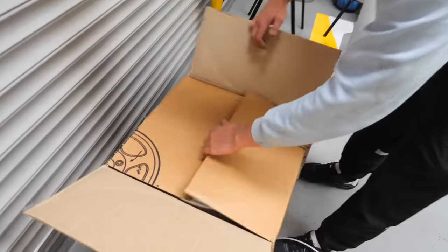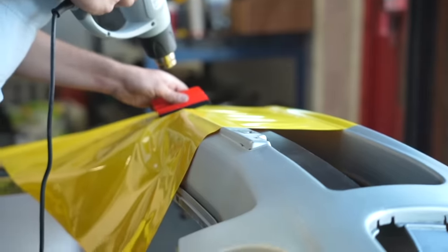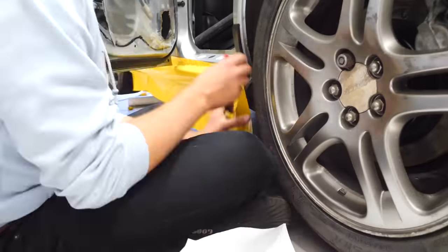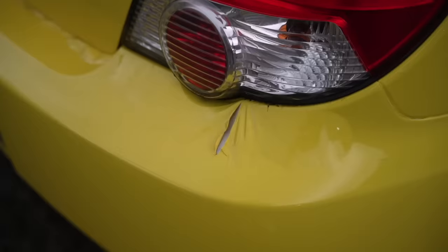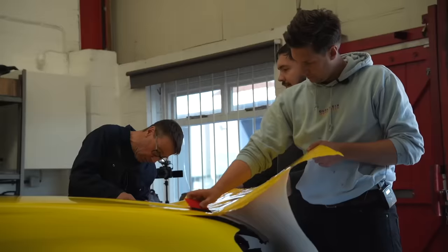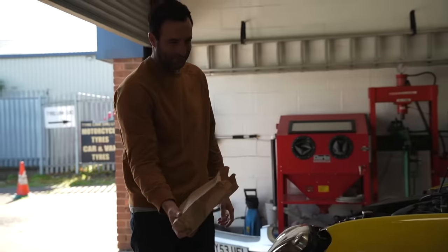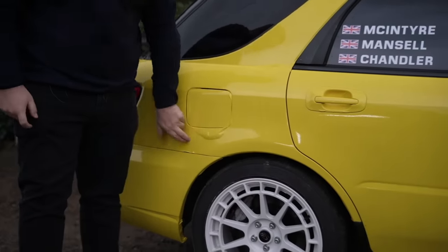Scott's gift was a brand new set of wheels that worked perfectly against our bright yellow wrap. Unfortunately, when amateurs wrap a car in a very short space of time with little to no patience, there are bound to be some quality issues. Our wrap hasn't fared too well and is already starting to peel and lift. I'd recommend DIY wrapping only if you've got the time and the patience to do it properly — and make sure you post-heat the wrap. That's likely why ours is peeling so bad.